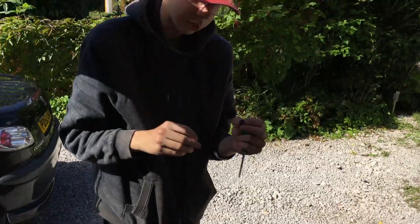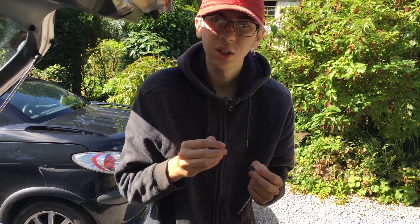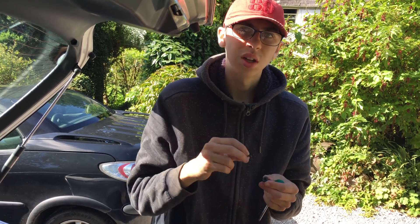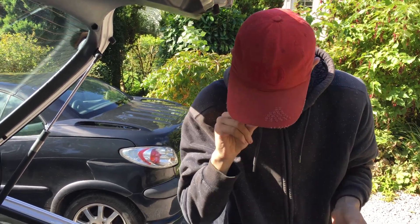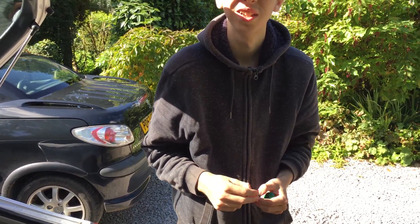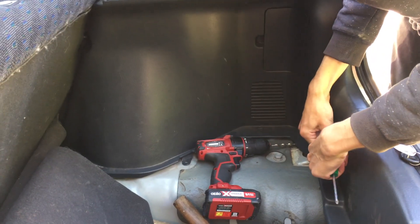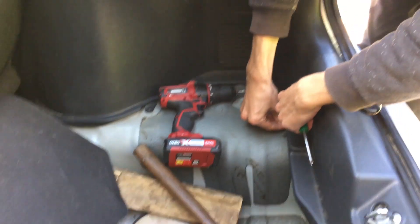These little clips — you put them in first and then the screws inside them, retaining clips, and the screws sit flush to it. If you're confused when you take them out and it looks odd with only a small bit coming out, just get these clips out — you can pull them out with a fingernail even on an older car. The EJ9 clips managed to slide out of the little sleeves on the door card without snapping, which is unheard of because the Mark 2 Golf eats them for fun. The EJ9 is being nice.